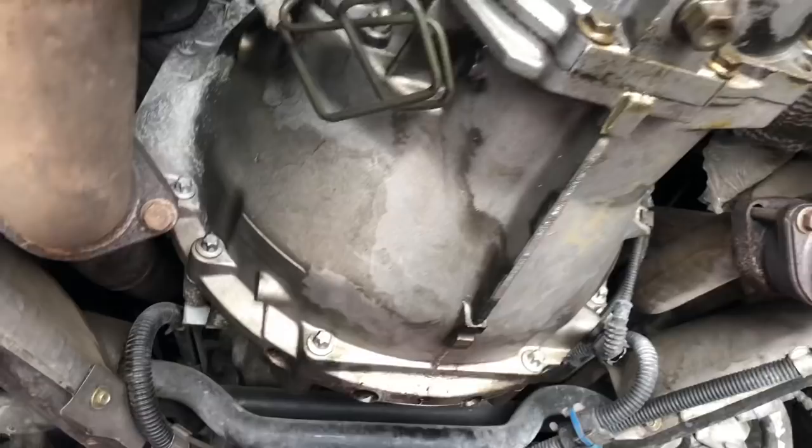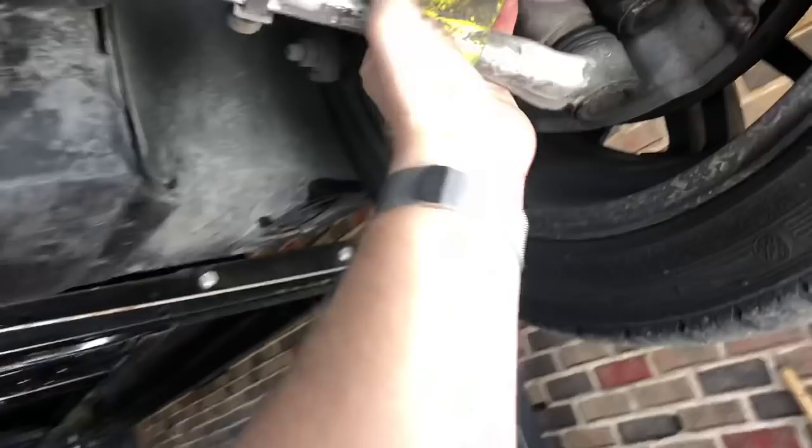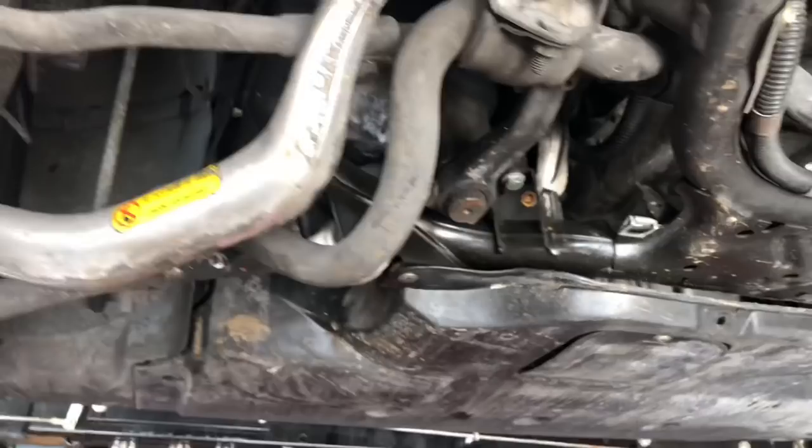No CDV — that's good. I don't think I'm going to change the trans oil; I feel like that's already been done and it drives really well. I do have thrust arms and control arms. Control arms actually feel really good; thrust arms are bad — shocker, every E39 I swear always has bad thrust arms. But just look how dry this thing is, it's so nice. I do have a teeny tiny little oil drip there, hopefully not from the rear main — but it looks like it is from the rear main. I can live with that; throw some LiquiMoly 2020 in there and drive it around this season. Most of the stuff this car needs is topside.